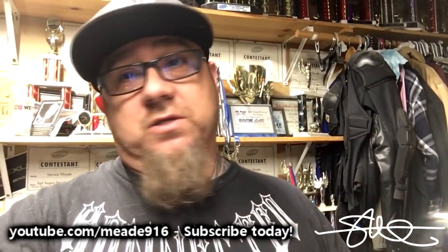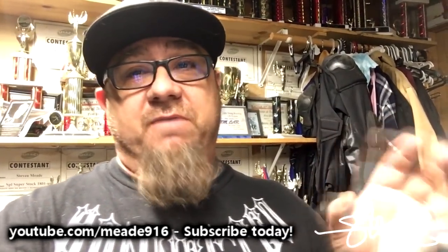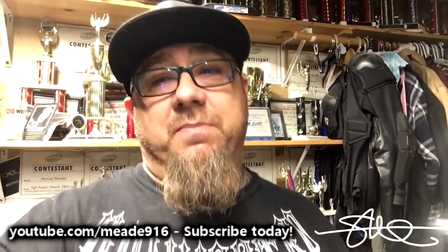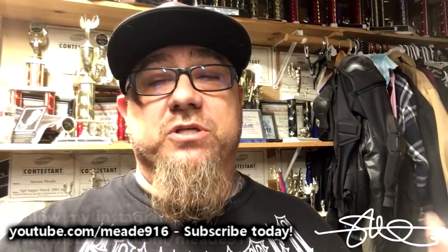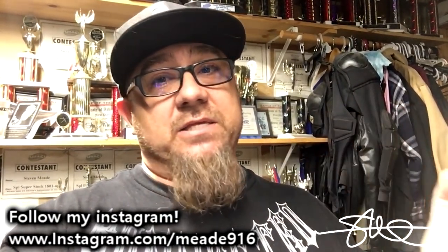So for me, my main benefit using these caps is I saved about 200 pounds on the very ass end of my truck. Also, those 8 cap banks more than keeps up and destroys those other 4 batteries that were in there when it comes to fast or anything that gives you a little bit of a break in between the beats. Now with sine waves, well, it's up in the air, but I still have 6 Group 31 batteries, and of course, I can't forget the 4 Mechman 350 amp alternators. So if you got the alternators like I do to fill up the caps and the batteries, it's a nice little mixture to have both.